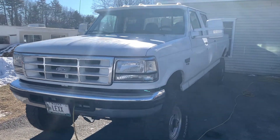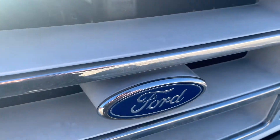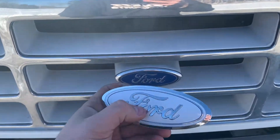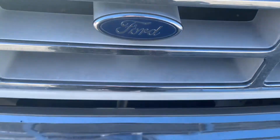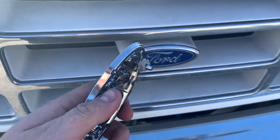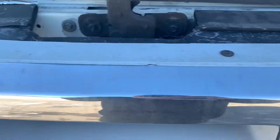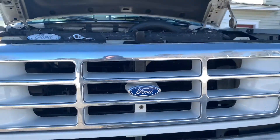So we've got another really cool clip for the Ford today. We got an aftermarket white emblem that's going to go on the front. It took a couple months to get it in — it had to get powder coated and all that fun stuff. But I am excited to put this on. Here's our new white emblem. You'll see it sits a little bit bigger than the stock one. The width is the width of the base and then it flares out just a little bit more to make it stand out. So what we're going to do now is pop this emblem off. The first step is you open up your hood and remove the four Phillips head screws on top. It seems we only have one right down here below the Ford emblem, so we're going to remove those now.